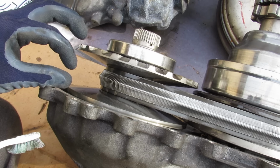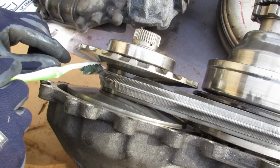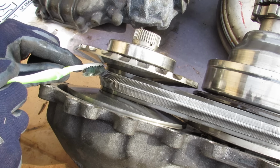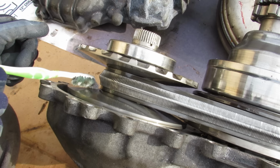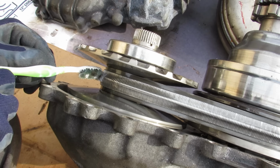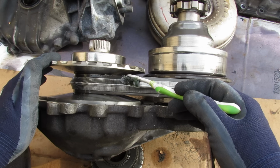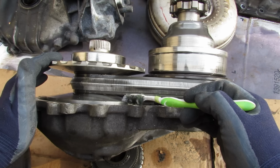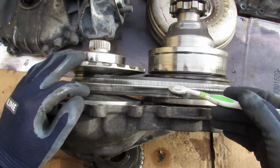When you squish this together, this belt is then going to be forced outward along this conical shape here and effectively change the diameter from inside of there to outside here, and that's because the width of this belt here has to remain the same. It can't squeeze the belt, so it's actually forcing the belt to come back out this way. Now of course, as this belt here rides up to the outside, its perimeter is going to increase, and that slack has to be taken up somewhere because the belt itself has a fixed length.